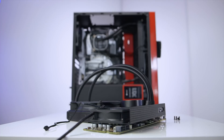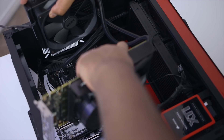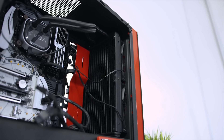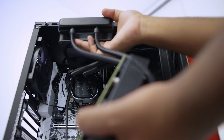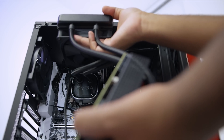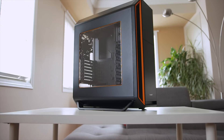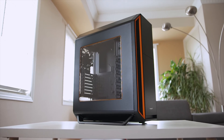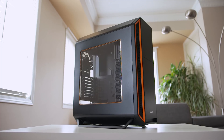I have to mention a few things before revealing the results. Mounting a GPU with an AIO cooler can be a little challenging especially inside compact cases. I'm using the X42 cooler from NZXT that comes with a 140mm radiator. The S340 case from NZXT has a lot of restraints when it comes to mounting a radiator, especially when you're also using a 240 or 280mm AIO for your processor — I tried mounting the radiator at the top and rear but the VRM heatsinks on the motherboard were getting in the way. So to provide an apples-to-apples comparison I chose the BeQuiet Silent Base 800 chassis to mount two liquid coolers, one for the CPU and one for the GPU.